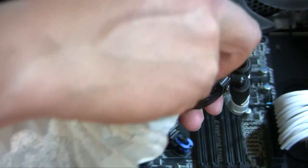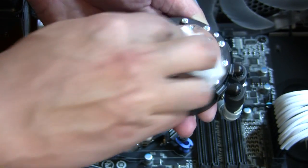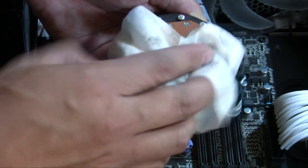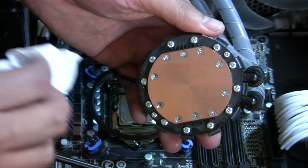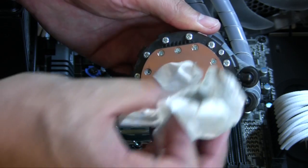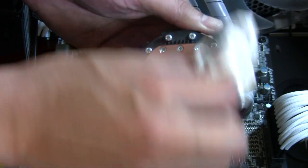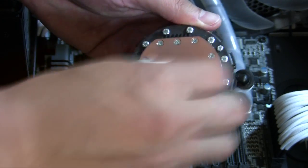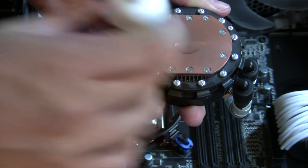I'm going to do a little bit more here. Once you do clean this off, you're going to want to let it sit for a few minutes — just let it dry off, make sure everything dries off properly. You always want to clean this off whenever you take this apart, because when I did my case swap in another video I was lazy and didn't clean off the old thermal paste and just added more, which is a big no-no.